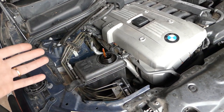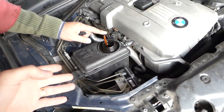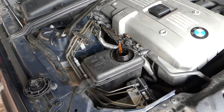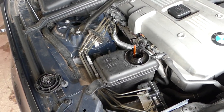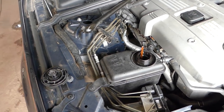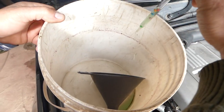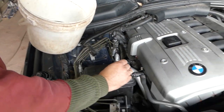It's been about 11 to 12 minutes and it stopped - the pump stopped circulating, so the procedure is ready. If there's too much coolant, you need to take some out. We'll show you using the antifreeze tester - we'll grab one quick and show you. You still need to do a few more things before it's ready. It would be really convenient if you have some kind of OBD scanner to check the actual engine temperature. If you have too much, you can test it and squish some out that way. They sell them for 90 cents at the parts store.